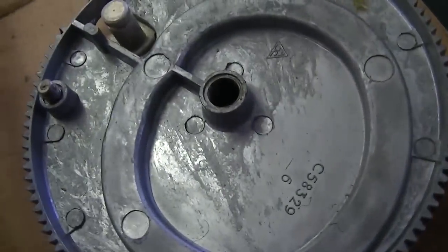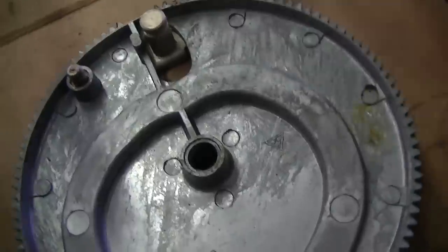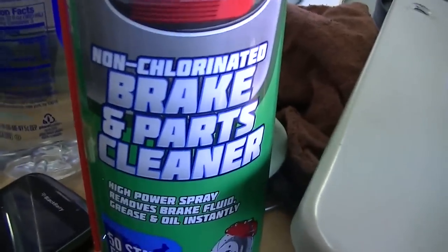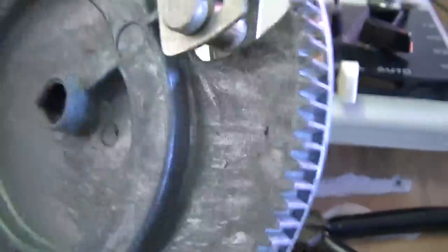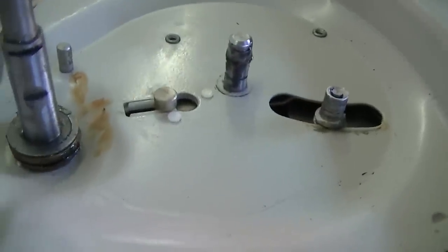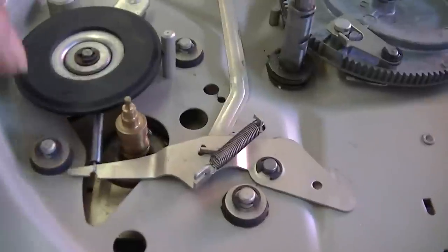All right, well, the dry grease is in here and in here. Very difficult. And I had to heat this up with a heat gun to get this apart. So I'm taking my time and I'm cleaning everything with brake parts cleaner, and I'm using just a little dab of this grease, and boy, look at that. Could hardly move that before. And this thing was so frozen to the stud there that it was turning the stud. Now it's all cleaned up and it rotates very easily. I think this is gonna be okay.